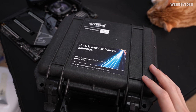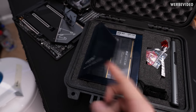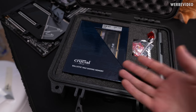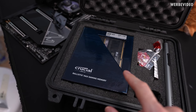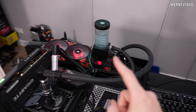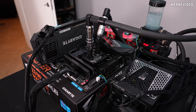This is also a perfect opportunity to use this Crucial Ballistix 5100MHz memory kit, which I received several weeks ago. I didn't see a reason to use it with AMD Ryzen CPUs due to the unlinked mode, but we know the 11th gen features a new memory controller. I'll test if it's as good as they say — 5100MHz CL19. The setup may look a bit trashy but we just need fixed parameters for temperature testing, with the pump at 35% and fans on manual fan speed.